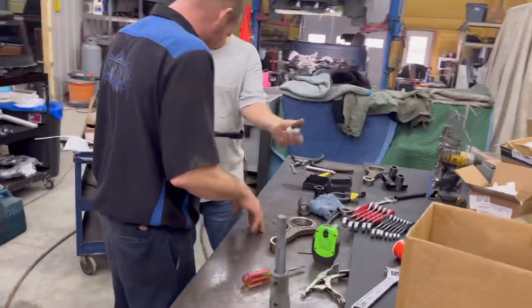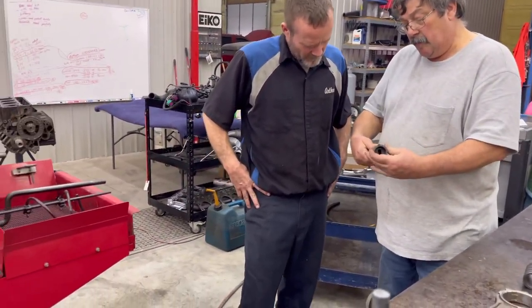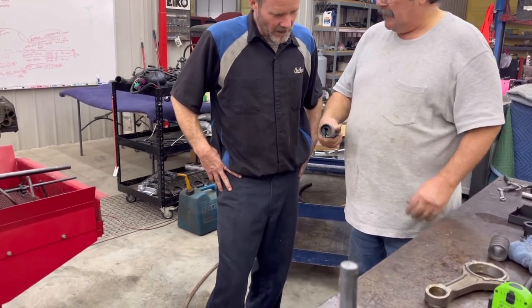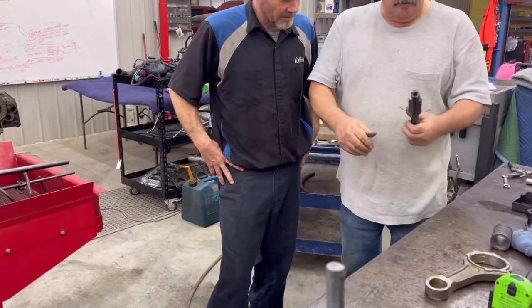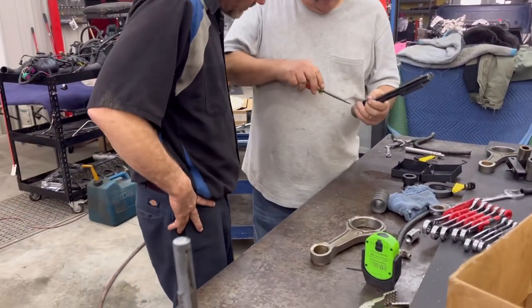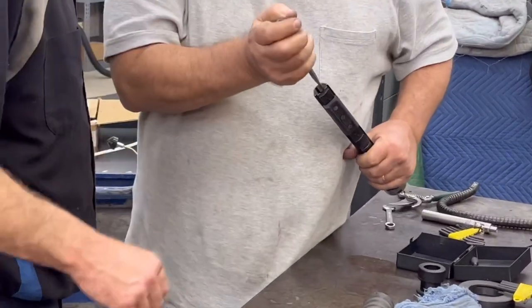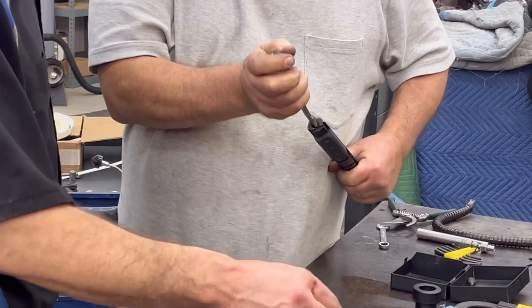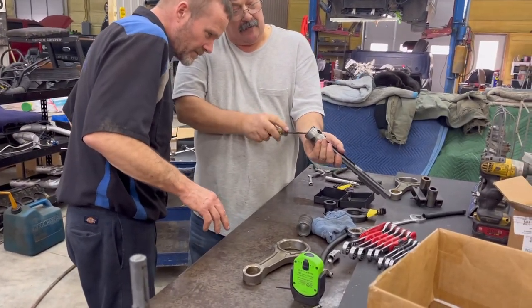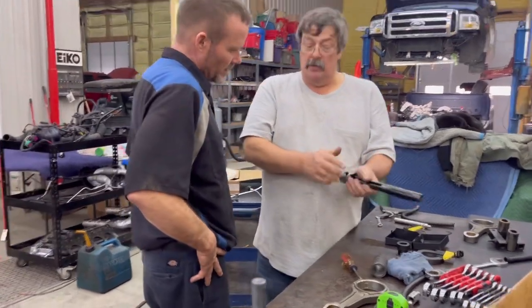This has the eccentric sleeve on it. Remember I showed you that before? That allows you to take some of the runout out depending on where you put it on the mandrel. So when you're loading the mandrel, you've got to get this all the way out. Even a little further than that. See how that catch is out past the flat here? Bring it out a little bit more. That's where it has to be when you load.